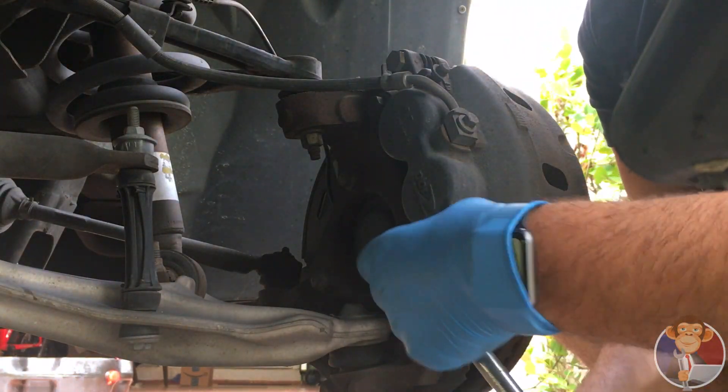Once you have that done, what we need to do next is go to the brake caliper and push the pistons back. I have a special tool I use for this — you can just pump it and go. But many people don't have this, so I'm going to show you how to do it with a cheap C-clamp that you can get at Home Depot, Harbor Freight, or Advanced Auto.